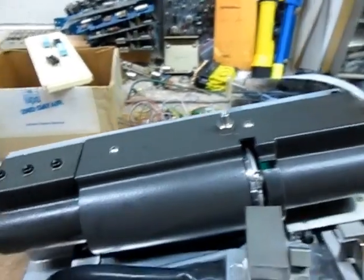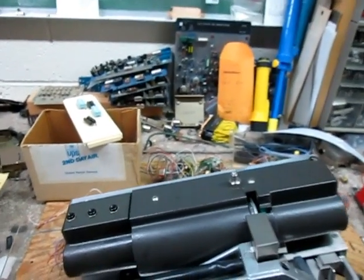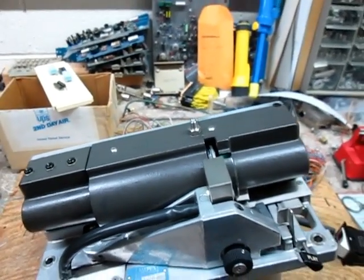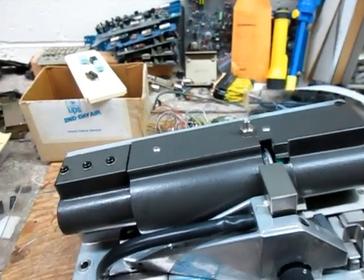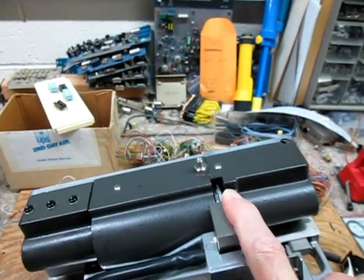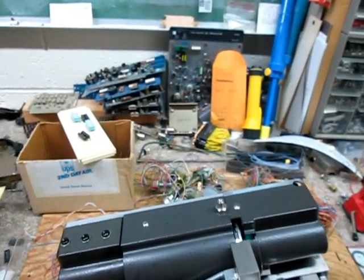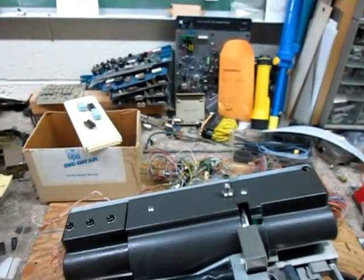So what I'm going to do today: the damaged parts of the tape are just a few feet — maybe six feet each — and there are two parts that were damaged. We couldn't play the damaged parts; they're so fragile. They will feed through the machine if the guide is not engaged with the head drum. What we want to do is recover the audio track intact, which is doable as long as we don't run that part against the spinning head drum.